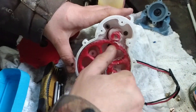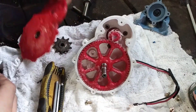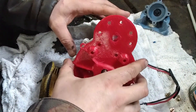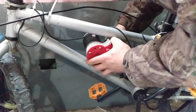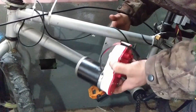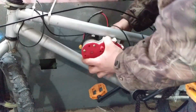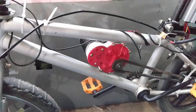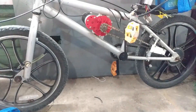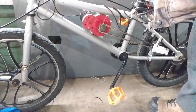A little bit of grease in the gearbox, put everything back together, mount it back on the bike, hook the chain back up, and I should be good to go for a test ride. With the lower final drive, it will be slower than I originally built it to be, but that's probably a good thing. On a little bike like this you don't really want to go too fast — there's not much for brakes here, and the bike itself is geared extremely low. I kind of like using this to just go slow in the bush and crawl around and explore.